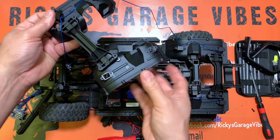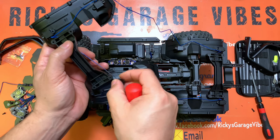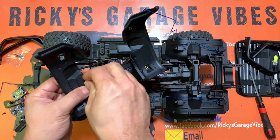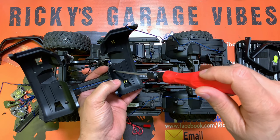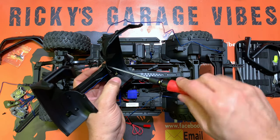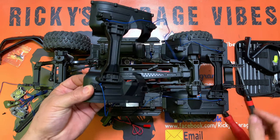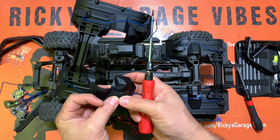Remember, loosen one screw so you can get the wire underneath. Put a screw on the bottom to keep it nice and steady. You want the wire to run underneath, away from anything it could get hung up on or squeezed by — run it under that piece of plastic on the fender well. Continue putting the rock lights in place, one single screw for each light but not too tight. Last one, and the fender wells are complete with the rock lights installed.